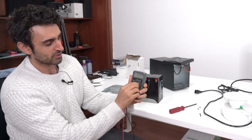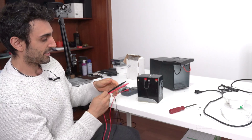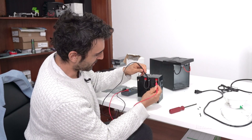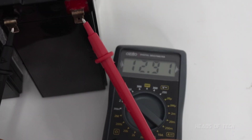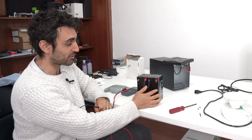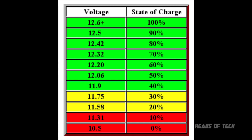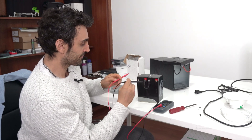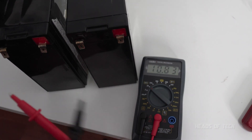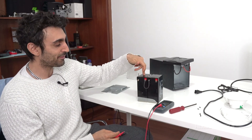The first thing I'm gonna do is get my multimeter out, switch it over to DC 20, and measure 12 volts. I'll put red on red and black on black. With the first battery I'm seeing 12.9 volts — this battery is perfect. Over 12 volts means it can charge up to 100%. Now on the other battery — it's the opposite way around — I'm seeing 10.8 volts. So this battery is 100% good and this one is letting the team down. Anything less than 12 means you've got a dud battery.